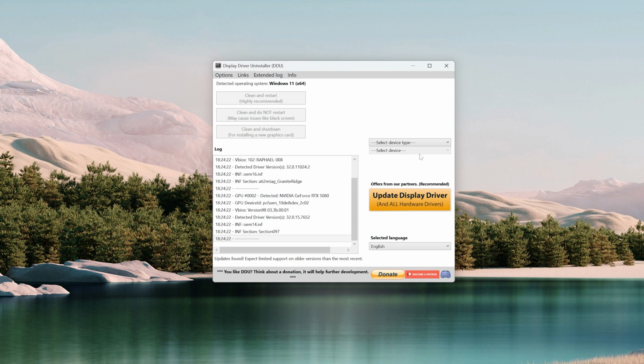When I first installed the card, the system crashed every 20 to 30 seconds. I installed the latest AMD drivers, which delayed crashes but didn't solve the problem completely. In City Skylines 2, it wouldn't launch at all. I tried removing the previous drivers, running DDU, rolling back drivers, and even forced PCIe Gen 4 in the BIOS. Still unstable. To fix it, a clean install of Windows. Once the OS was wiped and freshly installed, the system ran fine. These issues may not affect everyone, but highlight the fragile state of AMD's graphics drivers.